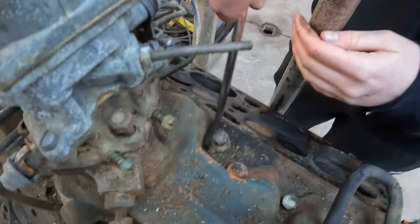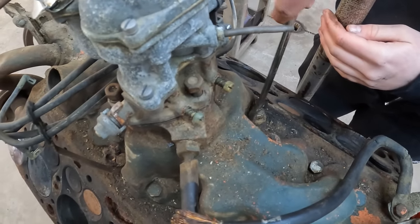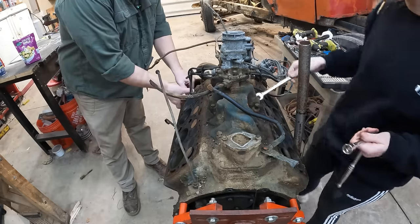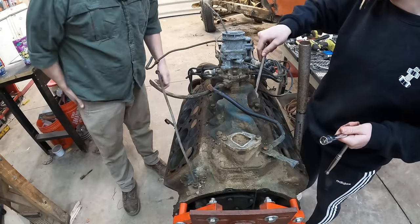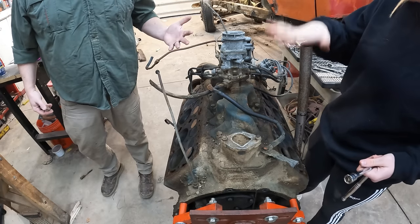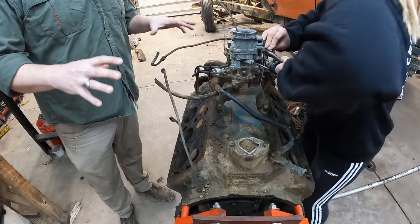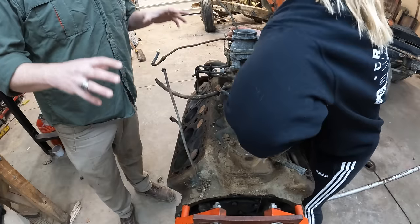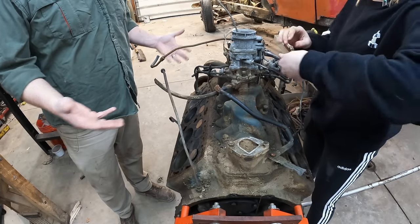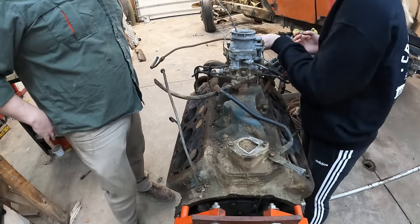This is so much easier going from the top. Caitlin's figuring out the mechanic hack, right here in live time. What? No way. This is an 8BA head, or an 8BA motor, which means if it's a Ford block, it came out in 1946. If it's a Mercury block, it came out in the early to mid 30s, 32, 36, I can't remember. An 8BA motor from Ford is a 100 horse motor in the truck. A Mercury 8BA is 110 horse, from the extra displacement. But these were only about a 6-to-1 compression ratio. They were not super high torque or high horsepower motors in any capacity.